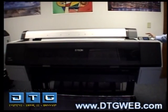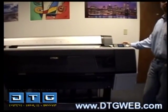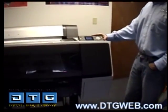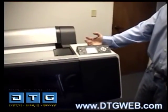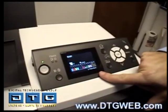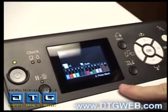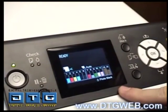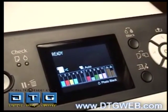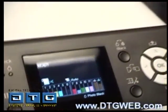After completing the head alignment, we've pretty much wrapped up the installation, assembly, and setup of the printer. The front panel has a color LCD with color indicators for each ink color, and to the far right are two brown bars that are the maintenance tank level indicators. When you run an ink clean or ink switch, that ink has to go somewhere — it goes into the maintenance tanks.